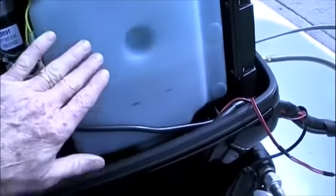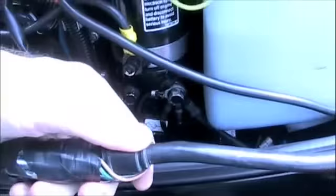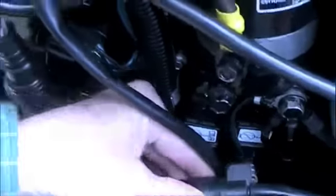Another thing while the hood is off: check your automatic oiler. Make sure it's full of oil — it'll ruin the engine if you let this run out. Fill it with oil before you go to the lake and keep a check on it each time you fill up with gas. Also, check your big connector wires where they join together — shake them and twist them to make sure they're tight. They could have corroded a little and not be making good contact. Just take a second to do it, then put them back down inside out of the way.